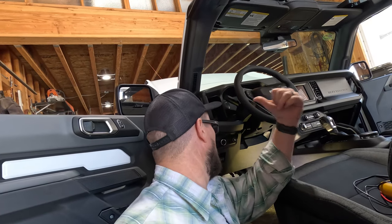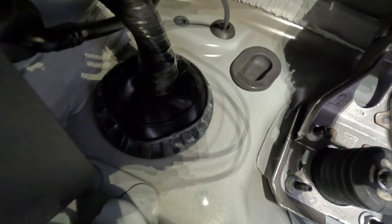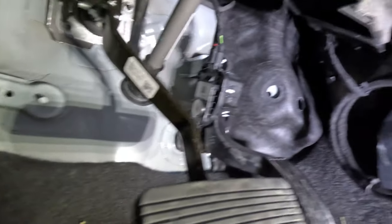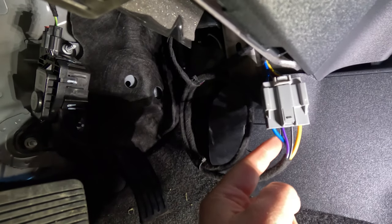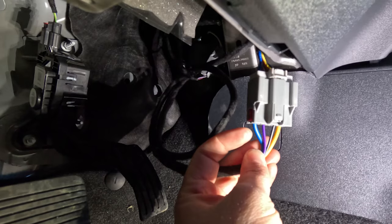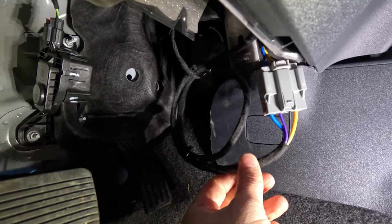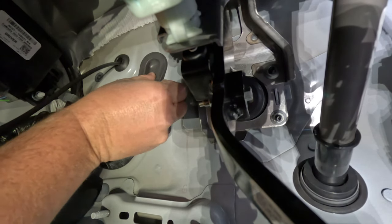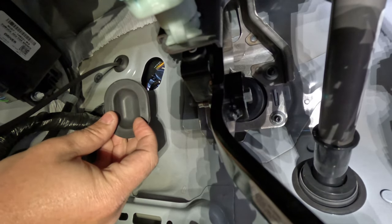Pop that guy off. Here's a cover that Ford put on there that we do not need. The wiring harness plugs right in and that will go right back into that. We're just going to roll this up right here, get it up out of our way, zip tie it and tuck it back up behind this panel. In my previous video we ran that blue wire that went from the back coming up here to the trailer brake controller, and we're going to have to pull that through the firewall. Now that little grommet right there is where we're planning on coming through the firewall, and then we're going to tie in on the aftermarket harness side of that blue wire. So that's going to control our trailer brakes and go all the way back to our seven-pin that we installed in my previous video.